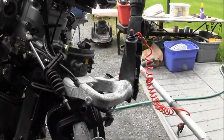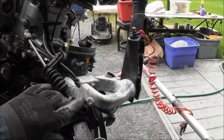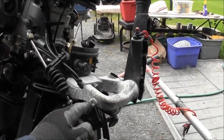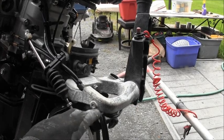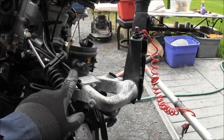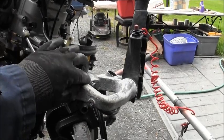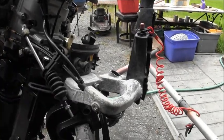that's where the shift handle goes, right there. You can see that bolt's broke off, but that's where the shift handle goes. So I have to drill me some pilot holes on the side, get some lube in there and some heat, and while not unhooking these wires and such. And get that out of there. Drill that out of there.